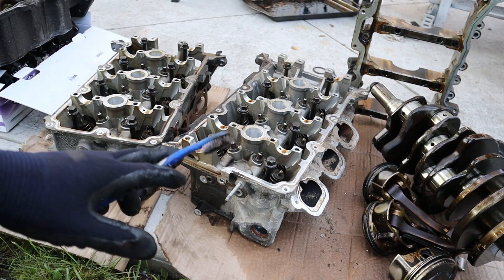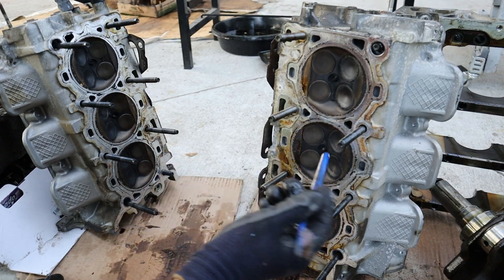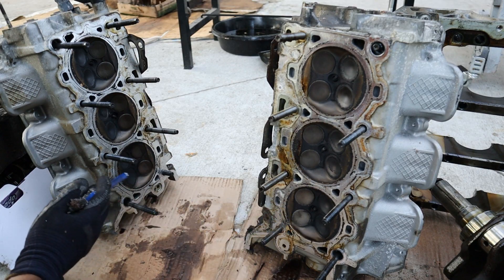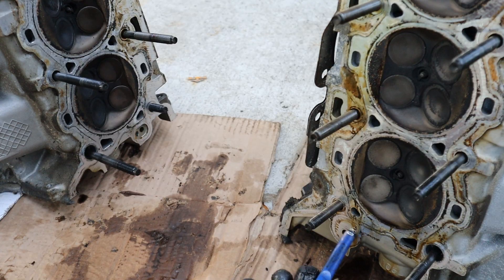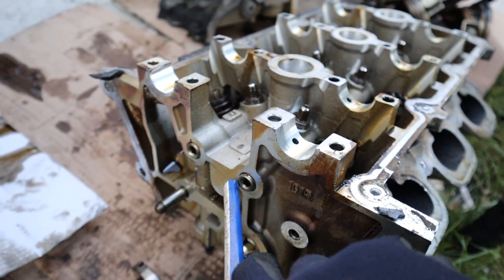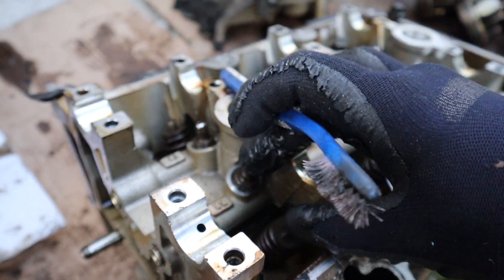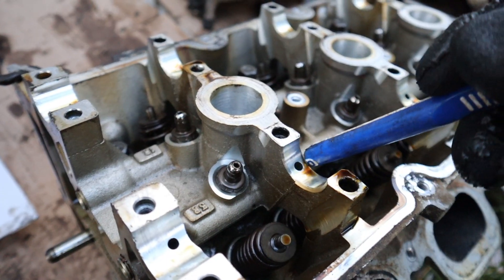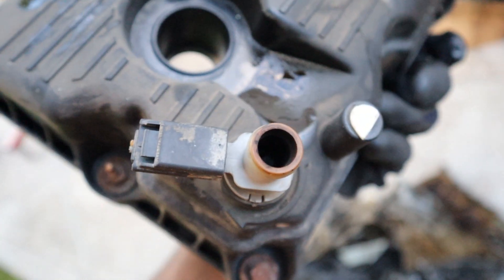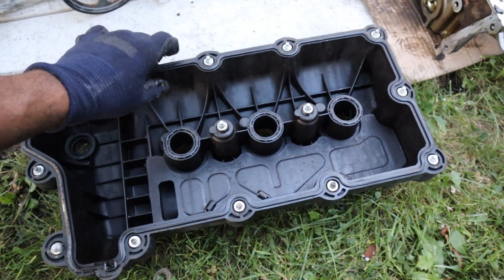The rest of the block itself is actually in decent shape despite what the bearings and oil pan look like. Taking a look under the heads, it's a very nice V shape with the intake and exhaust ports. Looks like this bank was burning a little bit too lean as these exhaust valves are white compared to the other bank. At the bottom, the oil holes are going to go up to power the variable valve timing and lubricate everything up top. Oil from the head makes its way to two galleries that run the length of the head to power the hydraulic lifters, which take up any lash between the camshafts. The valve cover itself is composite, but of course with all plastics they will eventually warp and leak.